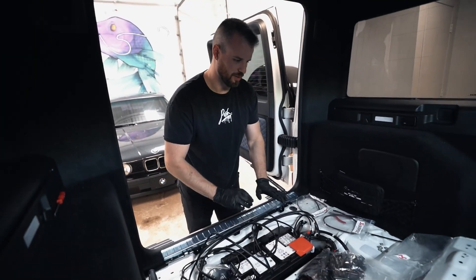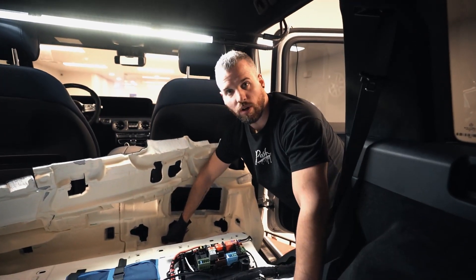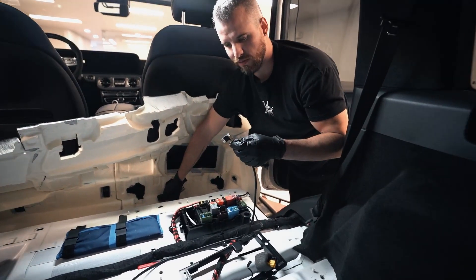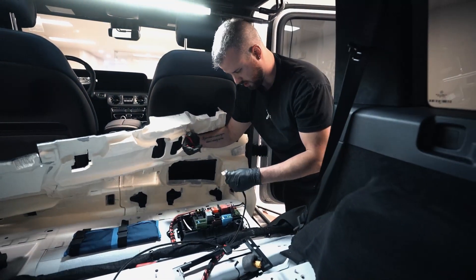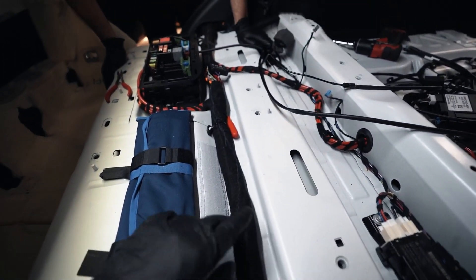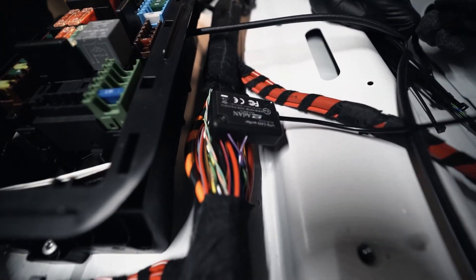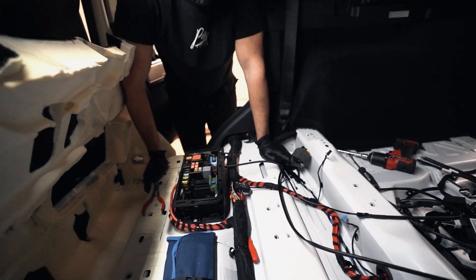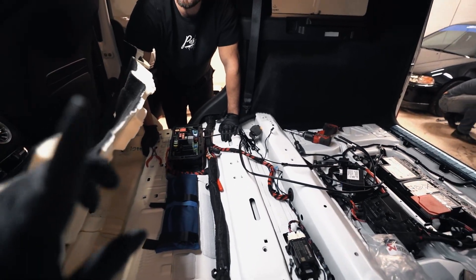So we get to make all this go into the G-Wagon and not interfere with normal stuff. From this point we're working with the sound kit. They've got this nice little add-a-fuse setup, so we basically just pull out the OEM fuse, tap it into here, drop this in, and run it all clean. The weirdest part of the whole setup is you actually tap into the main wiring harness with this little black box called a CAN sniffer. They show you the two wires you tap into but you actually don't tap into the wires — it basically just separates them and holds them through this magic little box. I don't really know how it works, but it works and it sounds good.